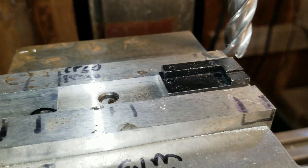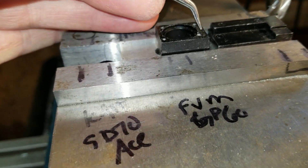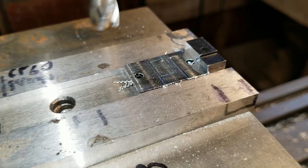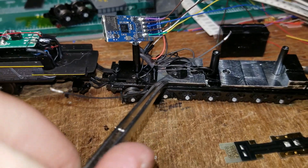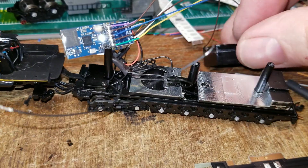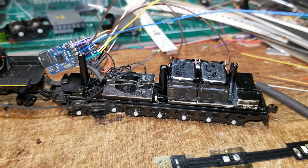I've got the weight from the Challenger clamped in here. I'm going to skim all of that off and remove a bit of this as well. When that's done I'm going to take the little speaker housing weight and machine it down so I can screw it back in the front — although there's going to be no speaker in there, the speaker's going to be back here. I'm back from my other shop which has the mill in it. I've cut this down so I still have some weight, and this little sugar cube fits in there almost perfectly — just a little bit of sanding and fitting.